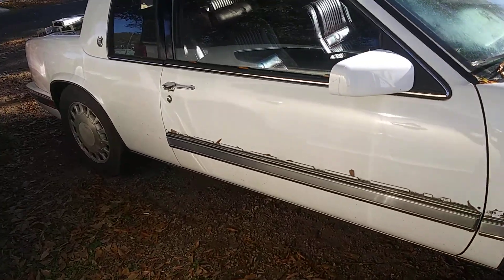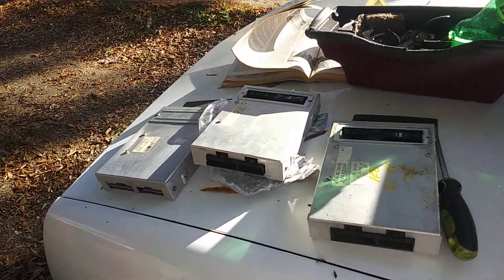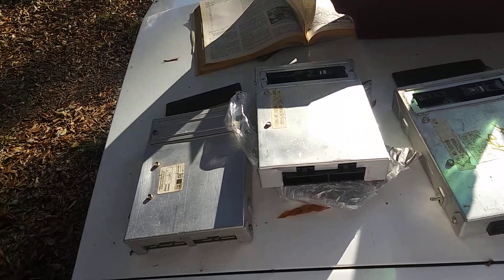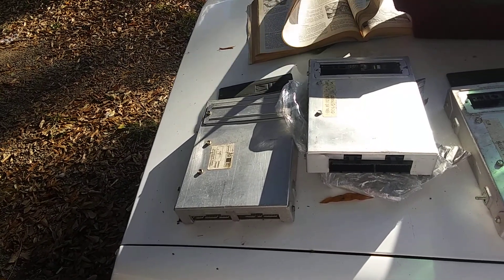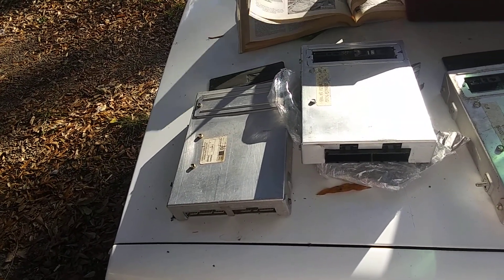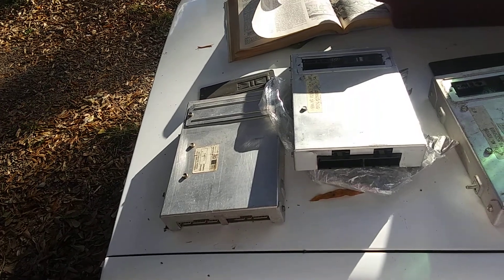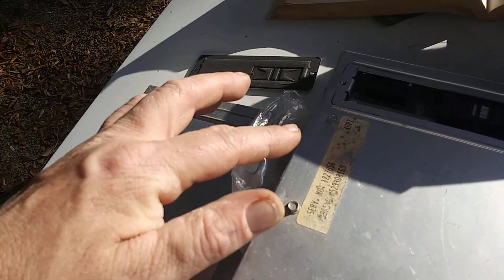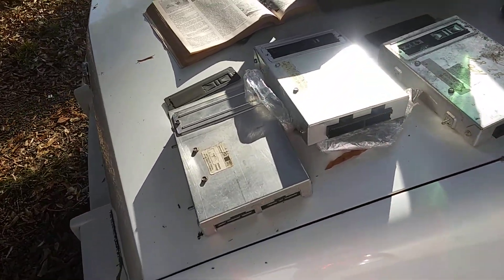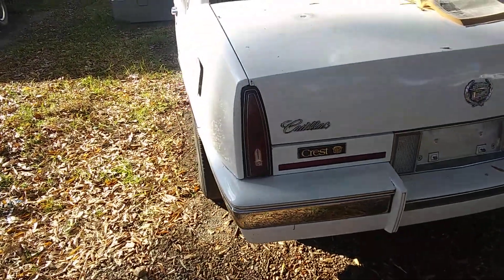I hope your projects are going well. I'm going to install this BCM, and I've got the ECM coming in soon because the ones I have are incorrect. That's my third and last bit of info: an ECM off an '89 Cadillac Seville will not interchange — it has to be an '86 or '87 ECM, possibly 1988 as well, but double-check and make sure the numbers line up. This is Alabama Deke, signing off for the day.